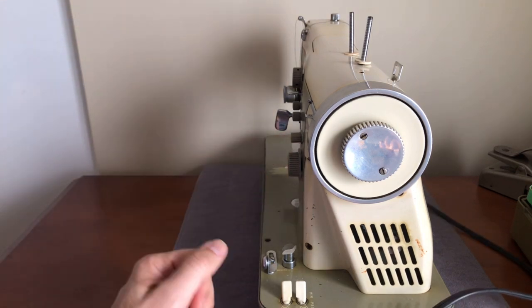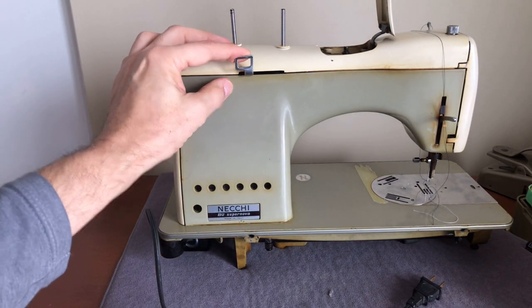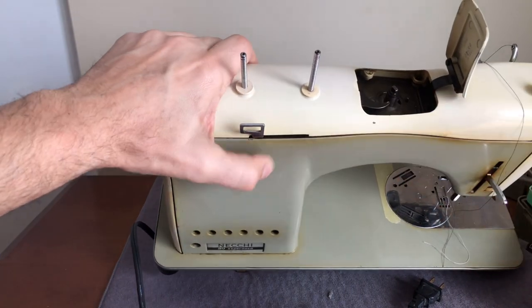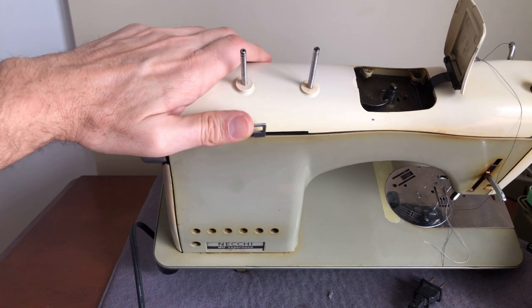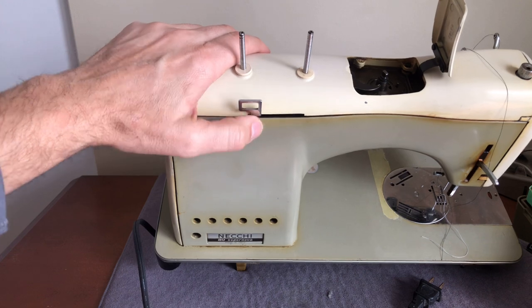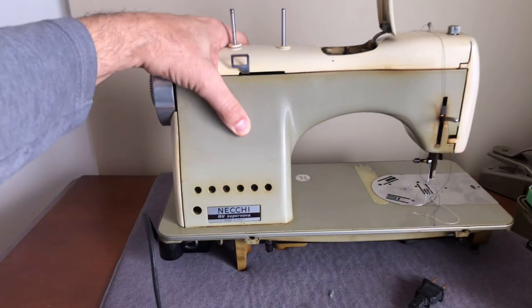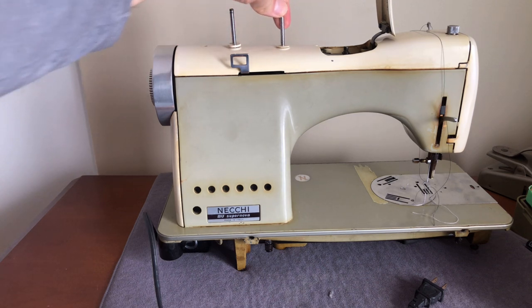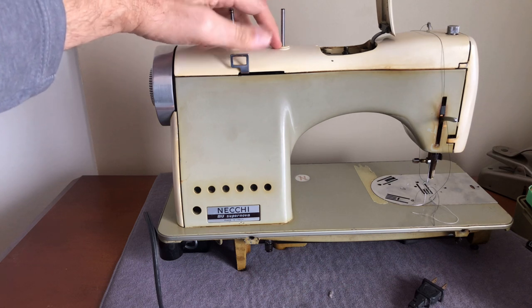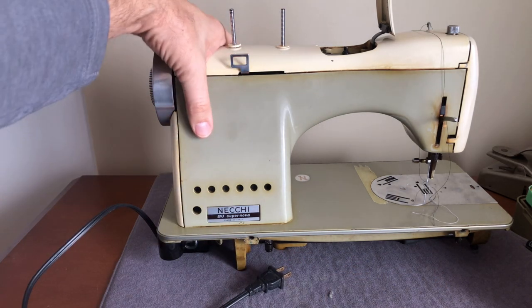On the side you have the vent — the motor is now covered. This is one of the first sewing machines where they began to put covers on the motor. In the case of this Italian company I think they may have done it for styling reasons. There's a little piece here that controls the cam arm, the cam follower. When I pull this toward me the arm moves — that's to help release the cam and then it should go back. This whole piece has got to be cleaned.